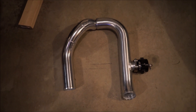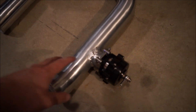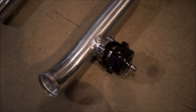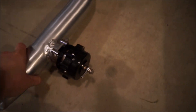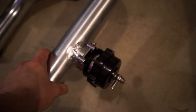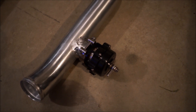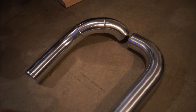The next thing to focus on is getting the hot side piping on. This is where I started my modifications — the original kit doesn't include a blow-off valve that vents to atmosphere for a blow-through application; they use a couple of ports for recirculation with a factory recirculation valve. So I had a buddy weld on this Tial Q blow-off valve, and I used the lightest spring I could get for it. This looks like a knockoff Tial Q so I'm hoping that spring functions well — if it doesn't I'll probably have to cut some coils. The other pipe I didn't modify.